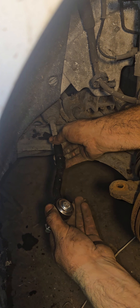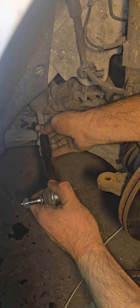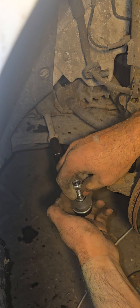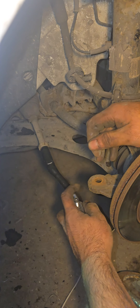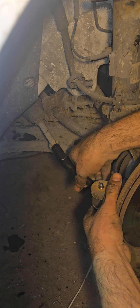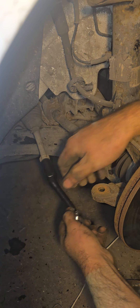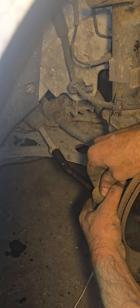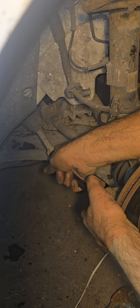It's turned a little bit, so I think that's enough. We can do an alignment at any time — I will check if the wheels pull or not, that's the best way to ensure it's aligned. You can't always get it perfect. Usually you should do an alignment every time you change suspension.